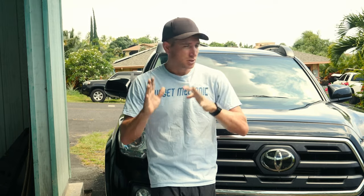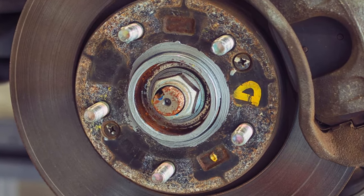That said, there may be circumstances where semi-metallic is a better option. If you live somewhere with a lot of hills and you're riding your brakes for long periods of time, producing a lot of heat, semi-metallic pads will dissipate that heat better and you're less likely to warp your rotors. Warped rotors are a high-cost problem — your steering wheel shakes and you have to get them shaved down or replaced, which is expensive. In a hilly situation, semi-metallic could actually be cheaper in the long run.